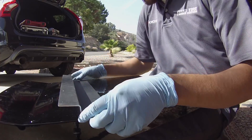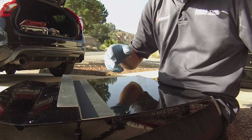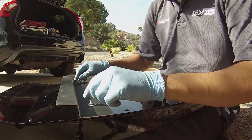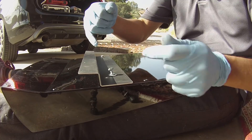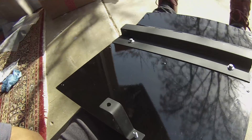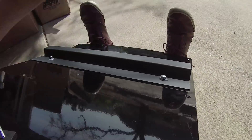So what I've gathered is this goes in this direction, and then we're gonna have to drill for the back hole, and we're gonna have to drill into this piece as well. I'm going to briefly mock it up right now. When I do this, I'm actually gonna have the bolts facing the other way so I can put a little touch of paint on the bottom of the mounting point inside — that way when this touches it, it'll mark where I need to drill. These bolts will be facing up so they're not sticking down and out in the way of airflow.